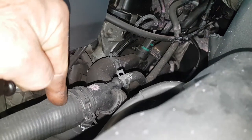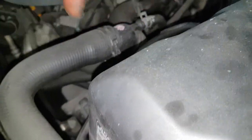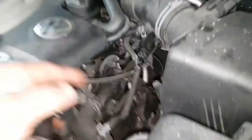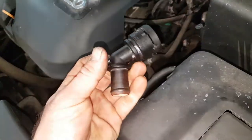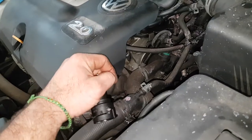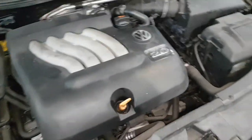This is where the hot water is — not the bottom area, bottom hose — it's a hot one, I'll change this as well. But knowing Volkswagen, that bit would come with all the hoses on it. There are other hoses here as well, the O-ring goes on there. In Europe it's so much cheaper — in Australia that's 30 dollars. If you're going to be doing the job, keeping the car, if it's overheated in the past — change it all, just change them all.